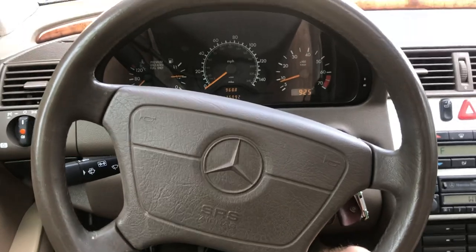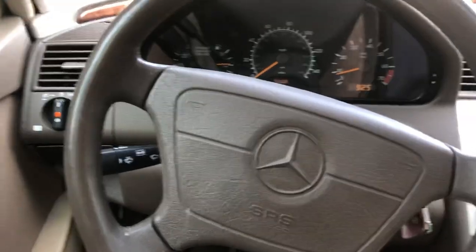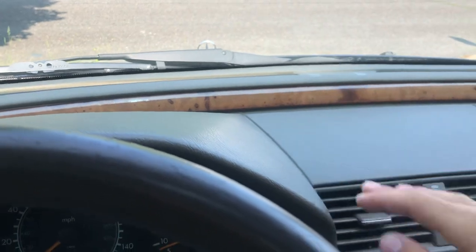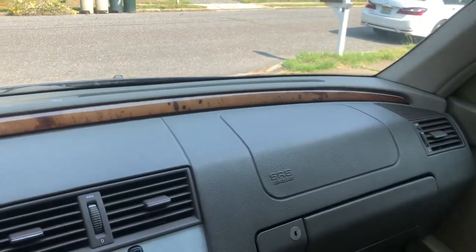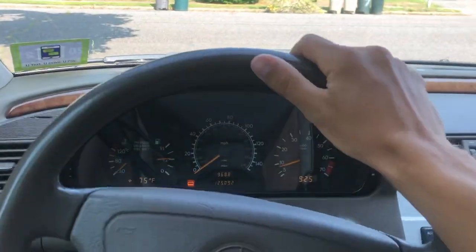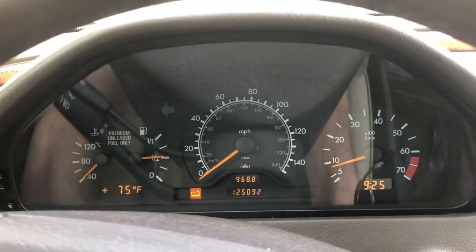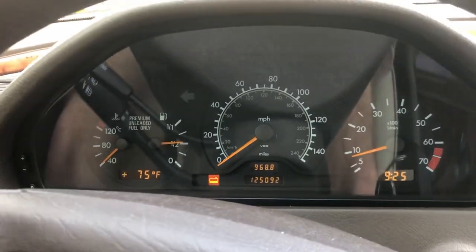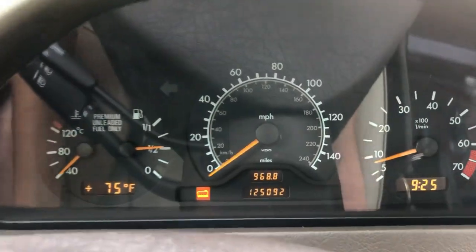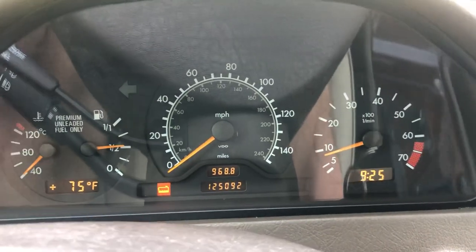When you're inside, you can notice it's actually pretty quiet in here — very well insulated. The interior is very nice as well. You can see you have wood trim above the dashboard, which I think is very elegant. You can see the Mercedes hood star from up front. Here's your gauge cluster — obviously you have your coolant temperature, your gas gauge, and an exterior temperature. There's a coolant warning light on, but the coolant is full and the engine doesn't overheat when you drive it for extended periods of time, so I think it's just a coolant level sensor.